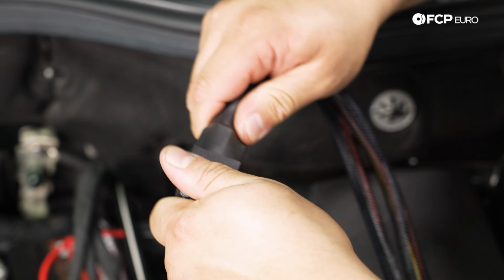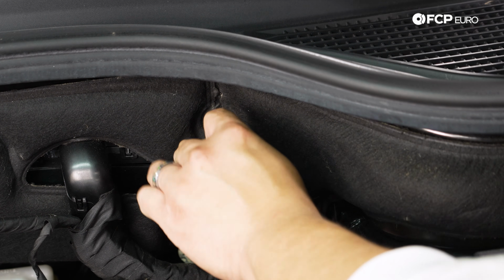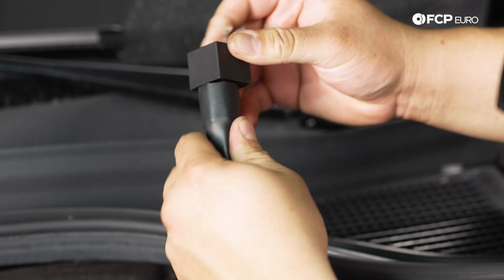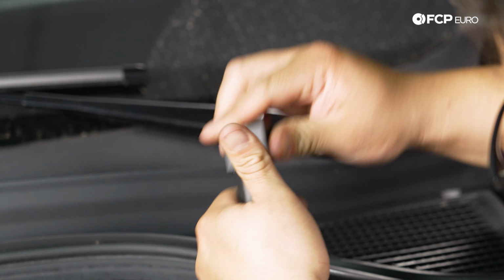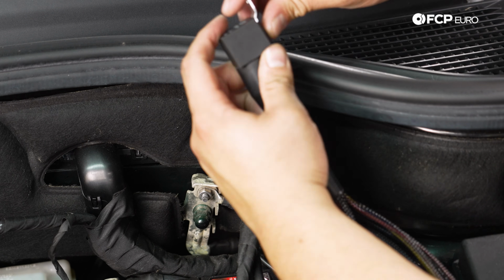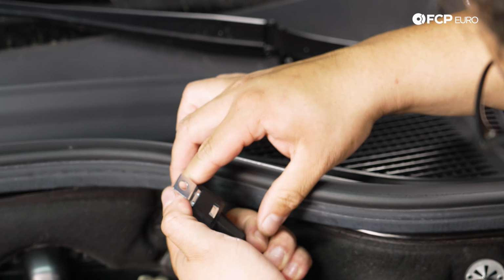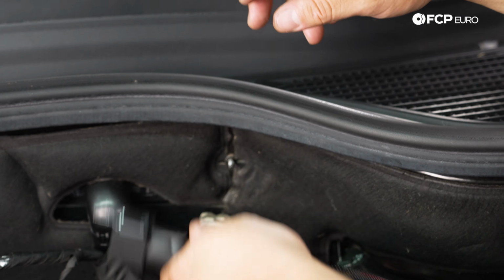Plug this baby in. It only goes in one way. All right. Tuck these down. Get this baby in like so. The fit on this is not ideal. So I'm going to throw, I think, a little bit of electrical tape on here. I don't want to. It's okay. No, it's not. I don't love the fit of the relay here. It's not the tightest. So I can either try to squeeze these terminals in a little bit more or run a little bead of electrical tape around the edge to keep this relay from falling off, which is, I think, what I'm going to do here.